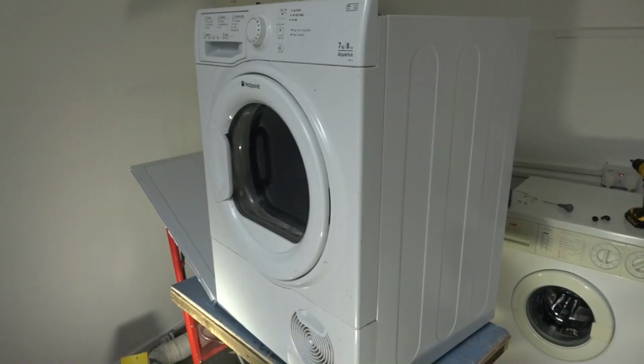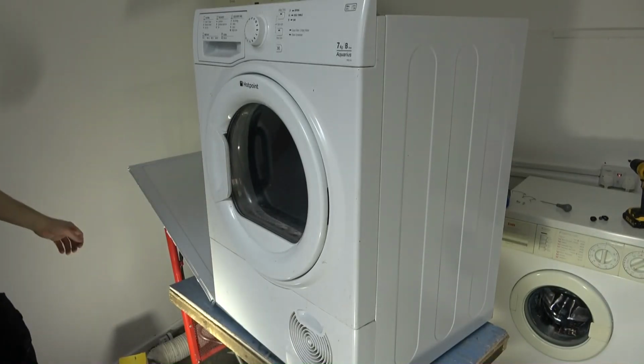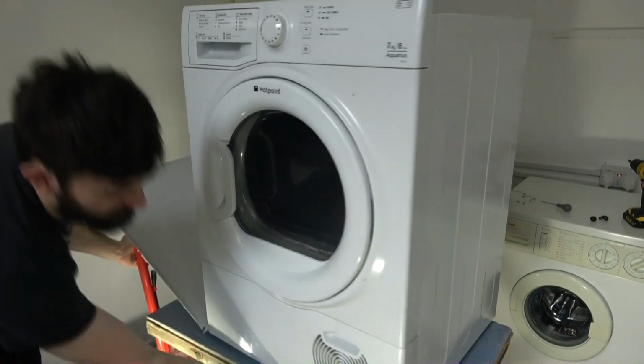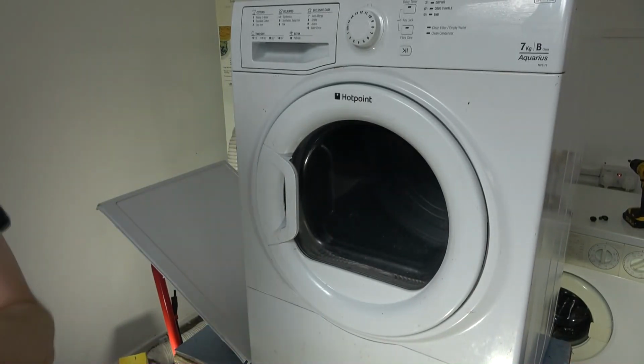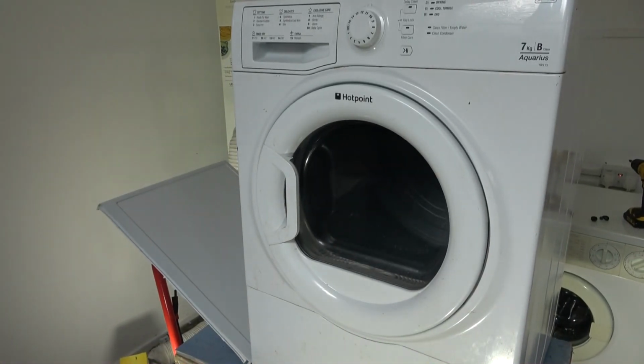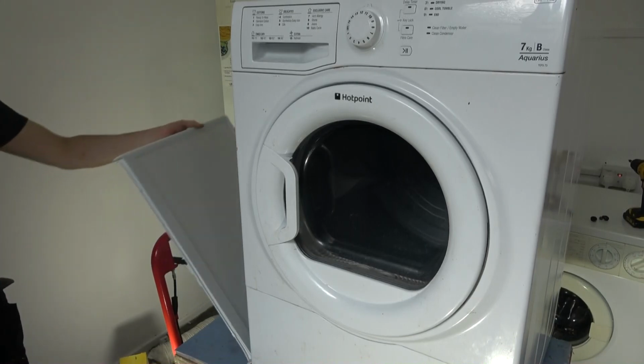Right, let's see if this Hotpoint now works. I've only reset the stat. Now, the trouble is, once the stat goes, it could do with replacing because it gets weakened, so it's more likely to trip again. Also, we still don't know exactly what's causing it to trip. So we'll plug it in and we'll have a go again. Now, before we do that,